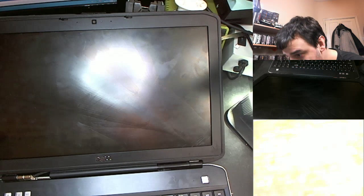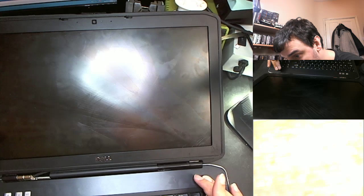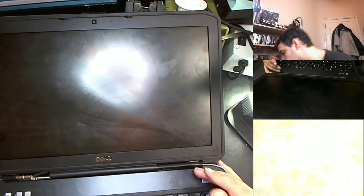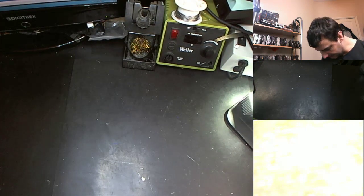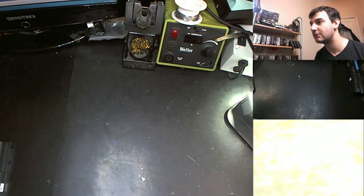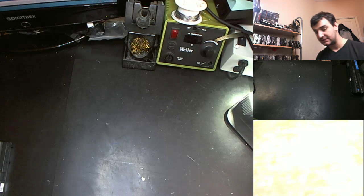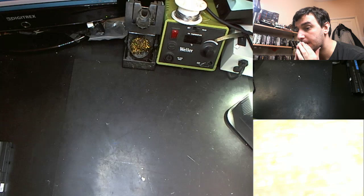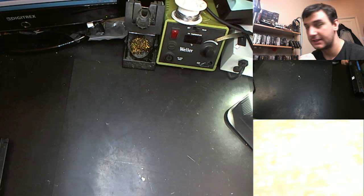I bought a new cable. I installed everything, you know. But with the original cable, when I powered it up, the screen became white, and I didn't know what was going on until I placed my hand on the back of the screen, where it was burning. When I took the cable out, the cable was almost shredded at the corner, you know. That was the 19 volt pins there. So I tested my screen again and the screen was fine. Unfortunately, I managed to get away really cheap.